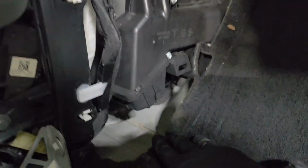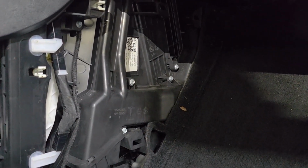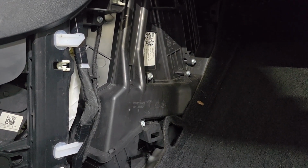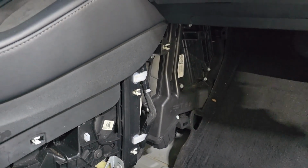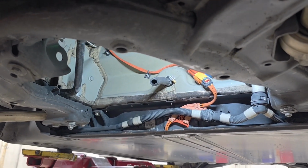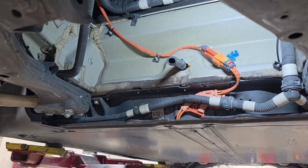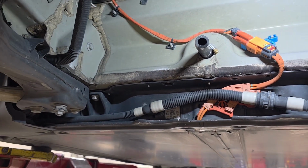But yeah, here it is. I just want to show you guys that this is where the evaporator is at. So there's no room to get to there. And that's also where your AC filter is at. And this was soaking wet. And I'm just simply showing you guys as I let it run for an hour to make sure that it wasn't getting back inside. And sure enough, there's no water here, nothing. And there's my new hose, there's the drip, follow the drip.